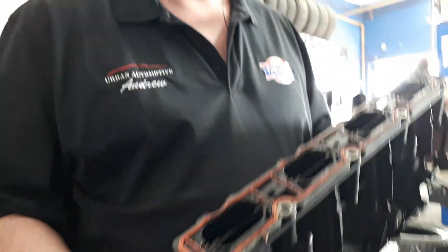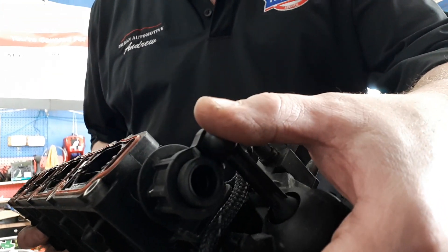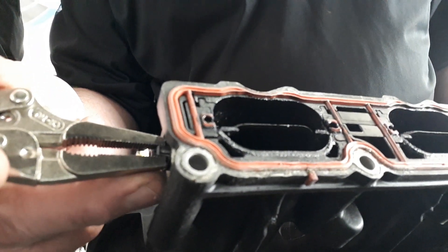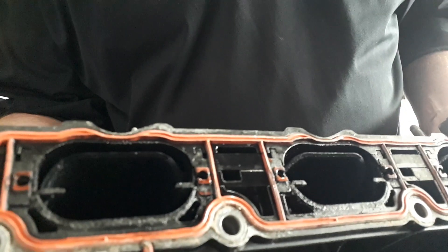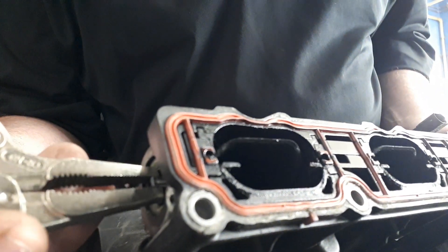In this case, what the issue was: this is the intake manifold here, and there is a vacuum-operated, through a vacuum switching valve, vacuum actuator here. These are the secondary throttle flaps, which move through the vacuum. And this is where the position sensor bolts on. But as you can see, it's come right off, and this is where it fails. What goes in there will go, but it only starts turning towards the end — it is not in sync at all. So this can be all the way open, and this is barely triggering the switch on the end because they're not moving in sync.